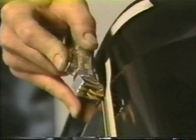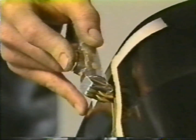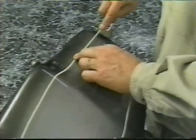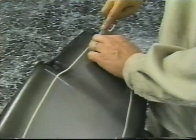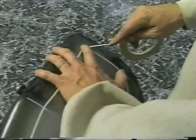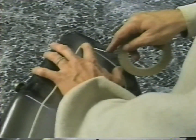Again, a small piece of masking tape can ensure a perfect flat edge to the end of your line. Narrow masking tape is more suitable for a reference line when striping tight curves. With little effort, you can shape your tape into any reference line, then follow the path with the Beugler tool.